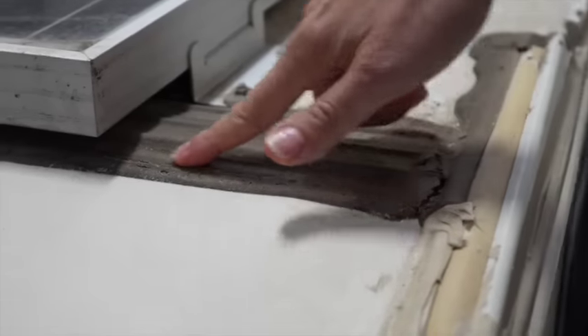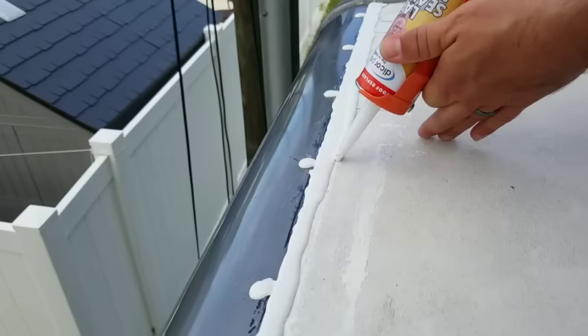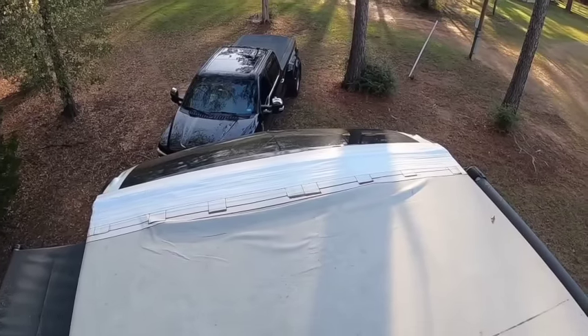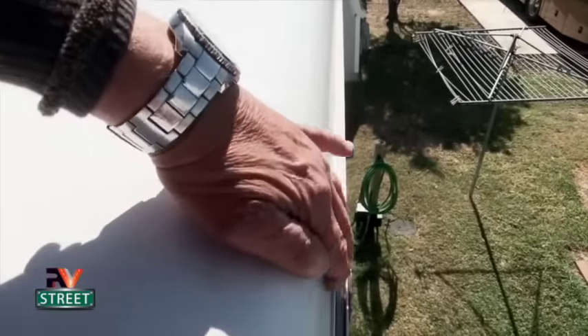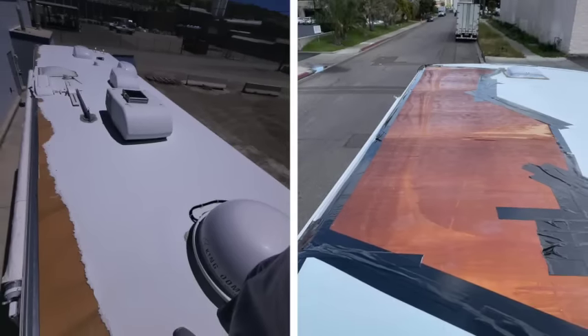Plus, you need to check all of your self-leveling lap sealants around every single accessory. RV roof sealant manufacturers themselves say that you should fully replace the roof sealant on your entire roof every single year, which usually costs around a thousand bucks depending on the length of your RV. A lot of times what happens is air will come underneath that seal and it eventually blows a bubble going down the freeway. Fiberglass roofs have a misconception that they don't wear out — they typically won't from general UV and rain, but the damage we see most often is where the fiberglass rolls over the sides, since it's usually just glued down with no solid aluminum or metal extrusion backing. That comes loose from RV flexing, springs back flat, air gets under it, and rips big chunks off — and the driver doesn't even know it's happening until it's too late.